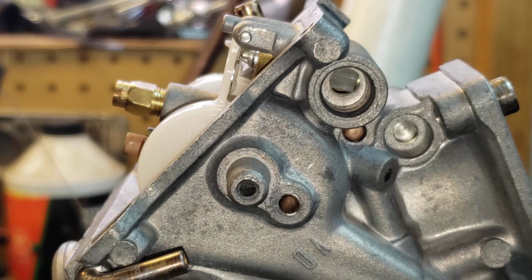So anyway, I'm not going to bore you with the details. You just bend that tab on the float back and forth to adjust it, and go from there. And just quadruple check your work, because it seems like it changes every time you check it, but I've got it to a satisfactory way to do it, and so anyway, there it is.